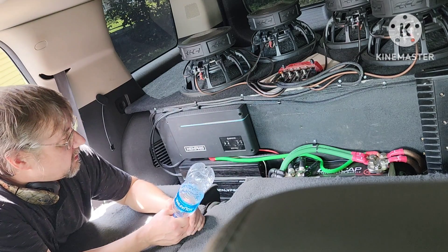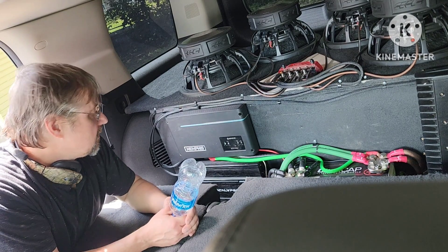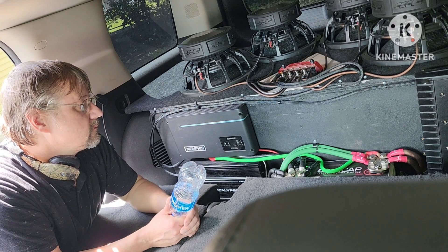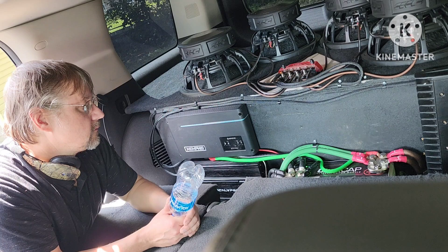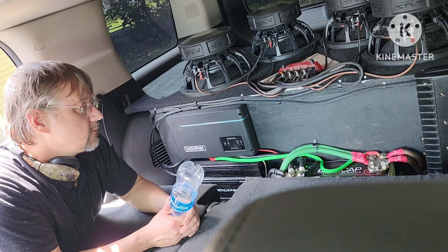It's cleaner and there's not a lot of extra weight. Even if you're running a regular car without a serious audio system, it will still benefit you — it'll make your starter happier, deliver higher voltage, and provide more power when you hit the key. It takes that pulse load off your battery, so your battery may last twice as long if you've got one of these alongside a normal battery in a normal vehicle.